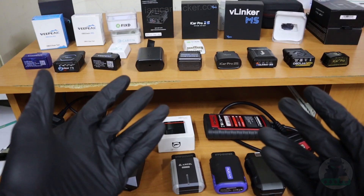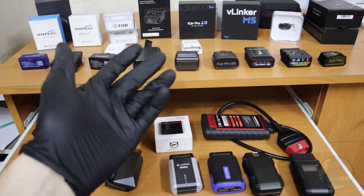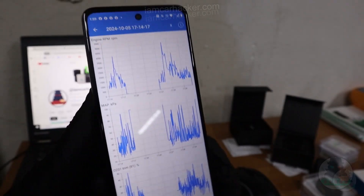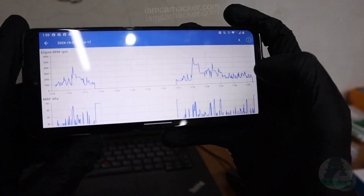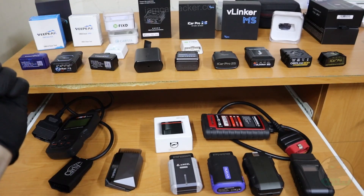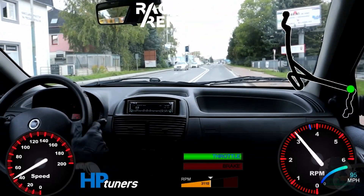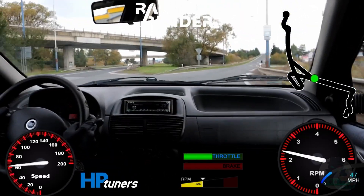That is how you should consider which type you need. ELM327 are good for basic engine diagnostics, tracking your engine data — you can plug one in your car and it will save data about your drives, location, log different engine parameters throughout your drive, track your fuel consumption. You can even make amazing looking videos with overlay of your engine data logged with one of these adapters.